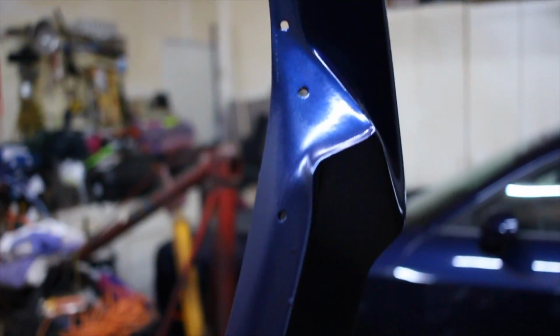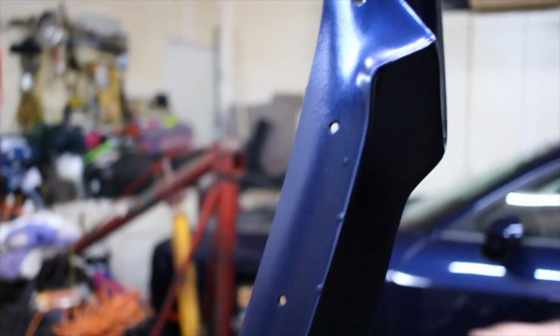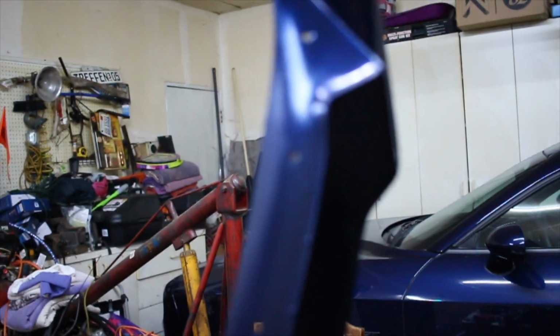So as you can tell, it looks pretty good. I'm pretty happy with it. There's a couple of runs there, but I'm going to wet sand it and fix that, so don't worry about that. Plus where it is, it kind of connects to the bumper, but I still want to get it fixed, just because I'd rather do it right once so it's done. So I'm going to let this dry overnight, and then I will see you guys in the morning.